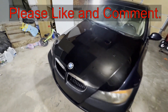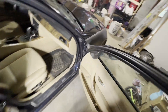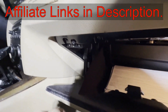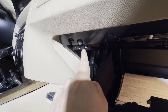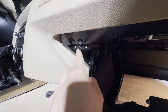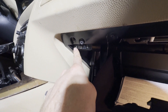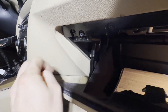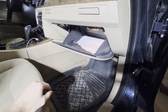We're going to come over here to the passenger side and open up the glove box. Right here you'll see there's a trunk switch for unlock and lock. It could be that your switch just got switched over to the lock position. If you switch it back over to the unlock position, your trunk should be able to unlock.